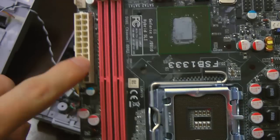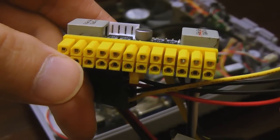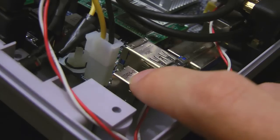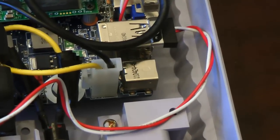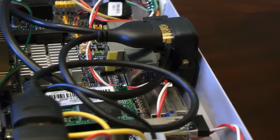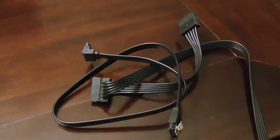I nearly had every component inside the enclosure and it all easily fit — except for one thing. This motherboard doesn't have a regular ATX plug for power. Instead it incorporates a DC power jack on the back. That was a problem because originally I was going to use a Pico PSU, which relies on a regular ATX plug. I had to find a way to route the DC jack to the back of the enclosure, which turned out to be nearly impossible. You can see how close the DC jack is to the edge — a normal cable won't fit without cutting a hole, and even angled DC connectors stuck out too far.